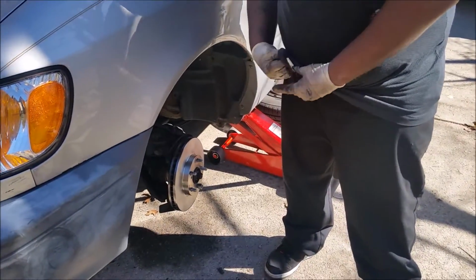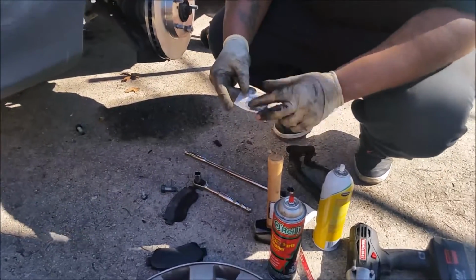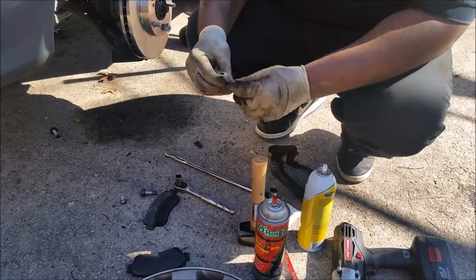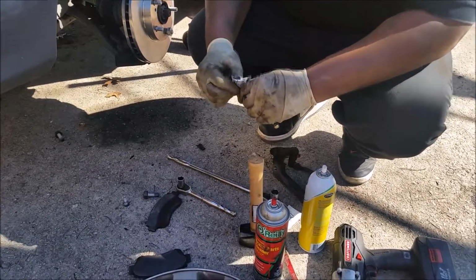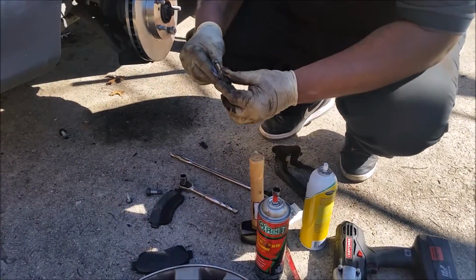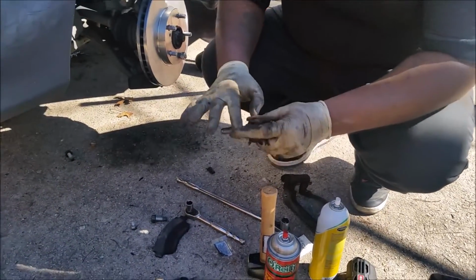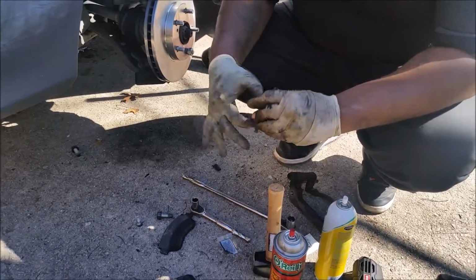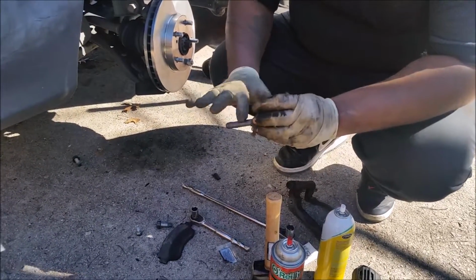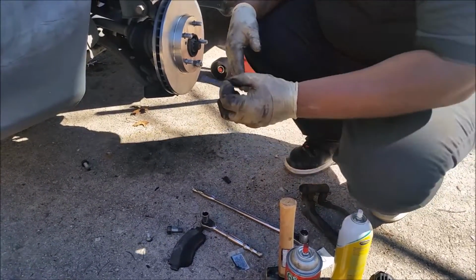And then typically grease comes with the parts, but you know, get some brake grease to lube it. And you've got two caliper pins. And just spread it. What is that? It's kind of a grease? Yeah, this is brake grease. But you can use wheel bearing grease, any anti-seize grease. Okay, very good.